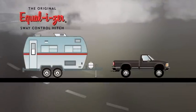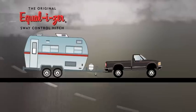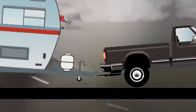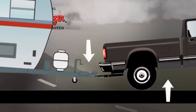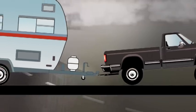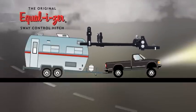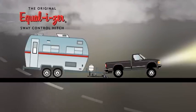How many times have you seen this? If you hook up your trailer and your truck's headlights are aimed at the treetops, something is wrong with ordinary hitches. Most of the trailer tongue weight gets carried on the back axle of the tow vehicle, which raises the front end. This uneven distribution is not only hard on your tow vehicle, it's also dangerous — especially during emergency maneuvers. Without proper weight distribution, you'll experience loss of steering control and braking power.